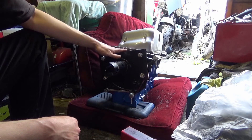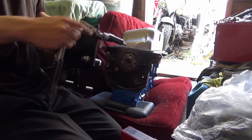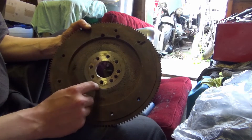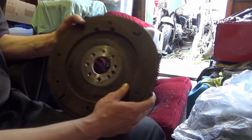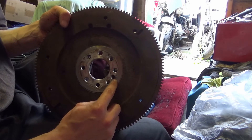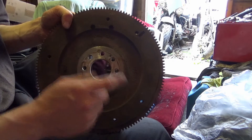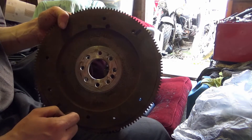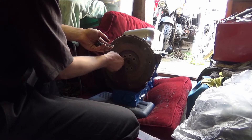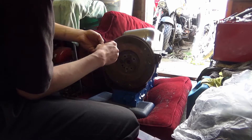As you can see the engine is upside down on the floor. I need to yank the engine bracket off by undoing all the bolts. This is the side that goes to the engine — it's got eight holes in it, and there's one in the middle which is off-center; that's a locating lug to position it correctly onto the bottom crank. We put the eight bolts in — they're 17mm — tighten them up, and one of the other holes will line up for the 8mm timing bar.